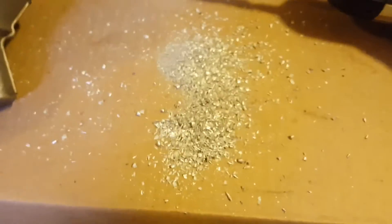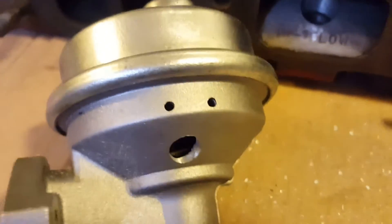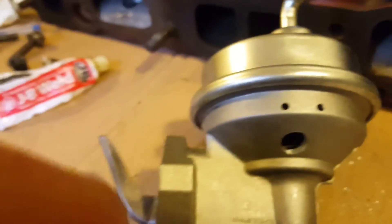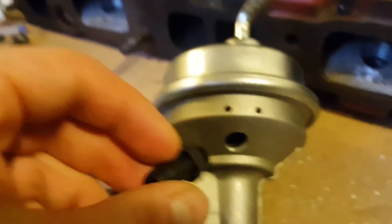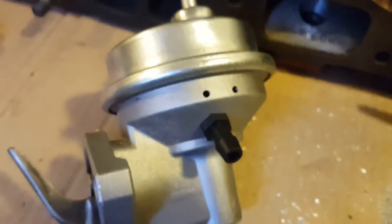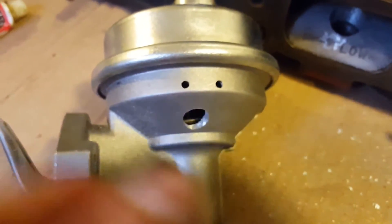The hole is drilled - doing it indoors makes quite a bit of mess. The walls of the pump are actually quite a bit thicker than I anticipated. Looking inside you can actually see a spring right in there, so just make sure you don't drill beyond the depth of the wall. I trimmed the threading on the fitting just a little bit so it won't make contact with the spring or interfere with any of the internals.